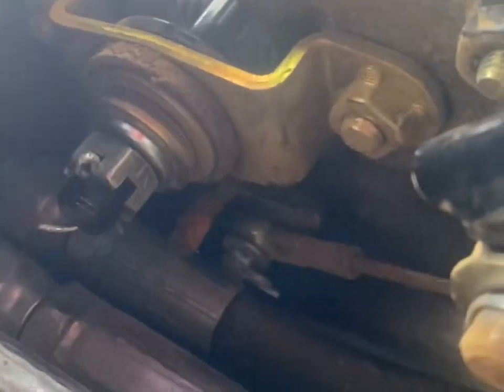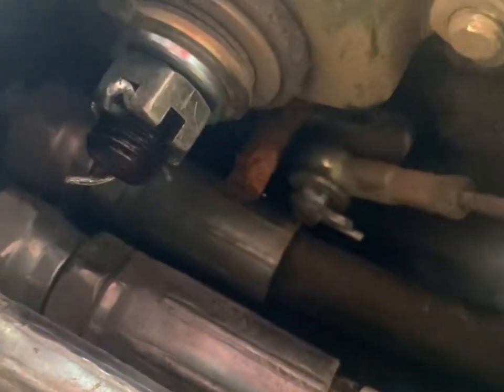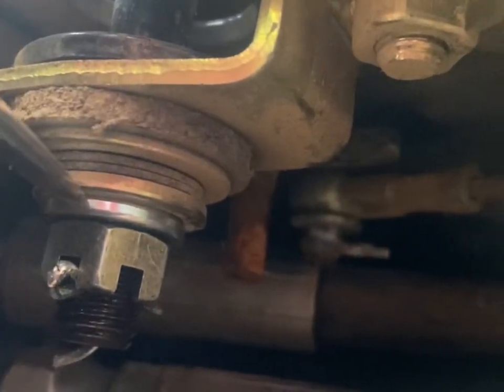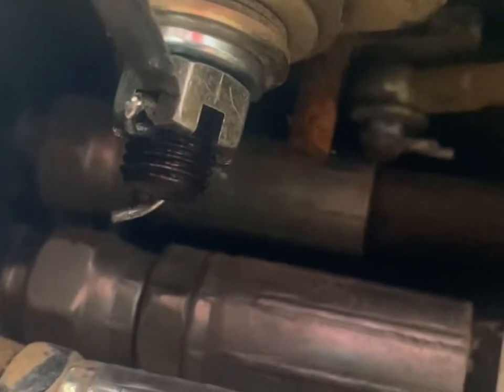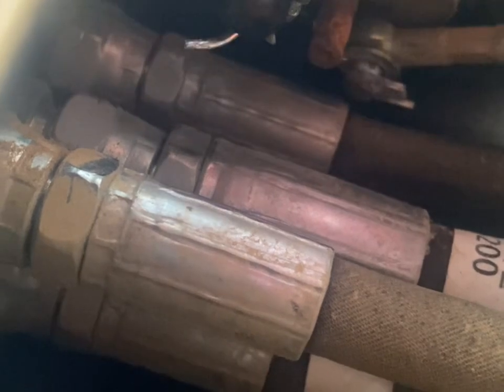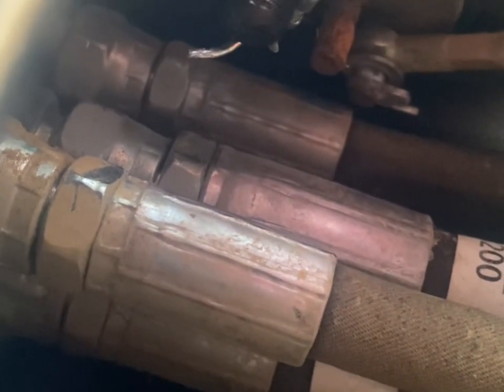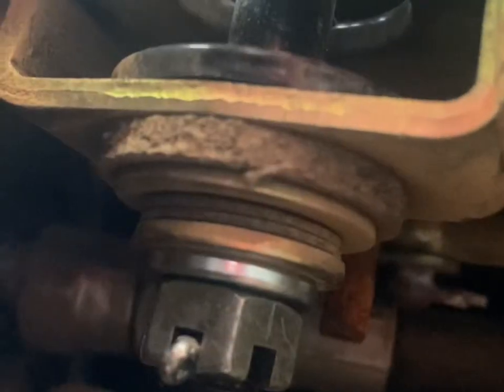I put the cotter key back in — it's right there on the end of my screwdriver. My nut seats against here; it's not super tight, but it should keep it spring-loaded. The cotter key is going to keep that nut, as well as some loctite I put on it. When you put cotter keys in, they don't have to be in any certain way to where it's impossible to get out — just bend one end to keep it in there and it'll hold. There's no real pressure on that nut trying to spin; it's only the amount of pressure you put on the hand lever. Try to make this easier on the next guy, or yourself, if you ever have to pull this back apart. That's it.